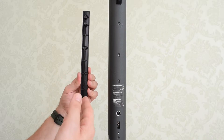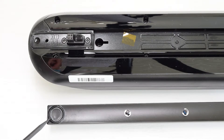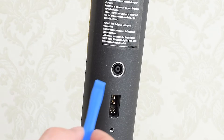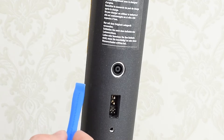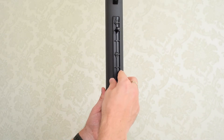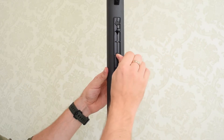What we need to do now is install the mounting bracket to the stem. As you can see, both the bracket and the battery have these rubber seals, which will cover these ports and prevent moisture from getting inside the stem. Align the bracket with the screw holes on the stem and secure it with the screws. Make sure to tighten these screws firmly.